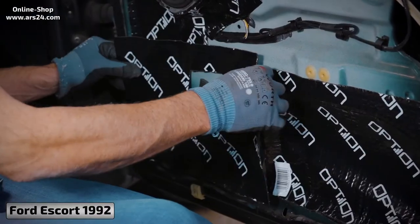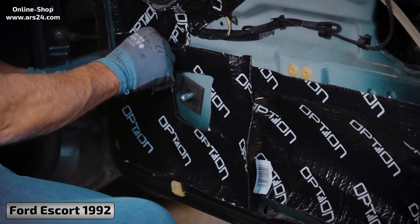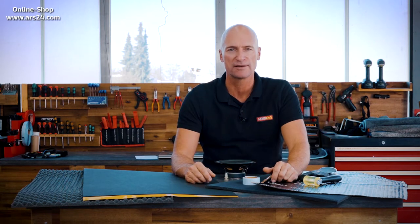How difficult is it to insulate and how long does it take? We have to assume that you normally insulate when you are already installing new loudspeakers in the door, so it's always the same procedure: first, dismantle the door panel. We have enough videos on our channel showing exactly that. Once the door panel is completely dismantled and the sheet metal surfaces are free in front of us, we only have to treat and stick our self-adhesive material accordingly. I estimate between one or two hours for an amateur — maybe more like two hours. Anyone who has already done something like this can do it in an hour. Take your time, it's worth it.